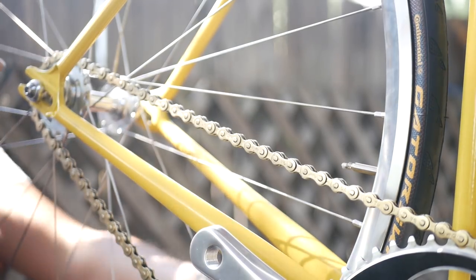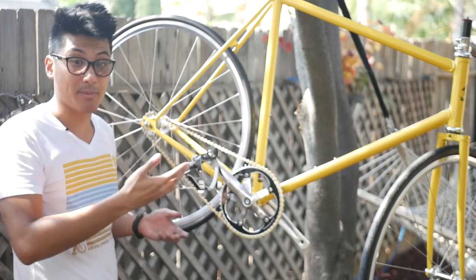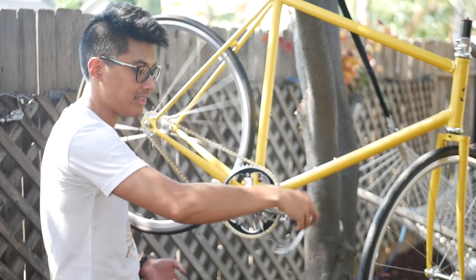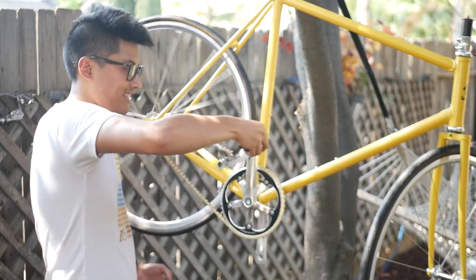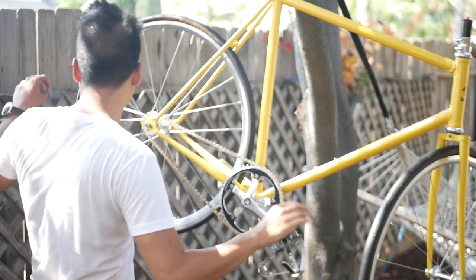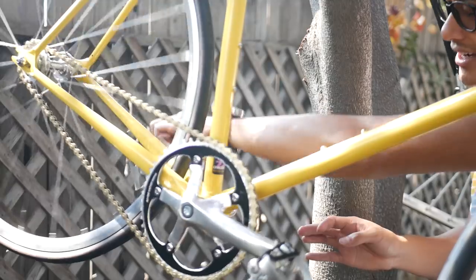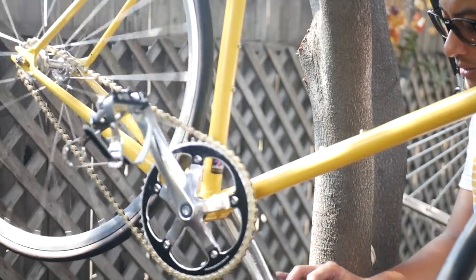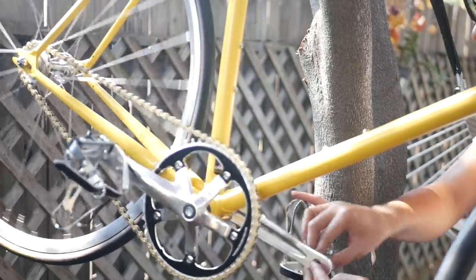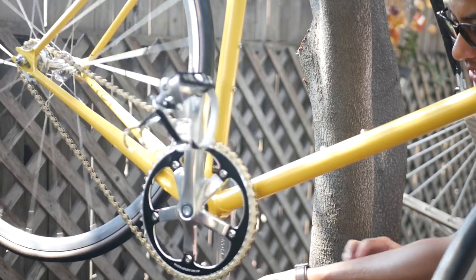Now to link your drivetrain together, put the chain on and tension it. That chain tension seems pretty good — just make sure it's centered. Now to put on the pedals: grab hold of the spindle and gently back pedal to get it in there. Once it's not spinning anymore from your finger force, take your Allen key and finish up the job. Pedal backwards while holding the spindle for the non-drive side as well. Something important: the non-drive side pedal spindle is reverse threading, meaning counterclockwise will tighten it.